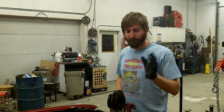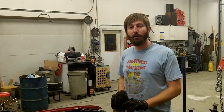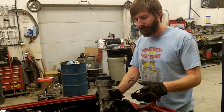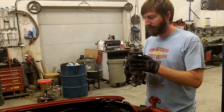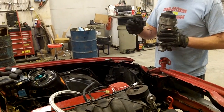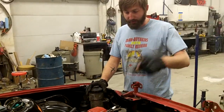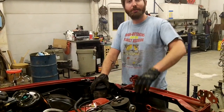All right, guys, we're gonna close this one out. We got our motor all bolted up. We got our transmission mount done. Gonna show you a couple of things we're gonna be working on next time. I did talk to some guys on the forum, and they said try not to run the aftermarket oil filter mount I was thinking of doing. So we're gonna rework our factory housing and mount it over here in our fender well. And we'll show you how that's gonna work. We cut our factory fittings down. We're gonna weld AN fittings to adapt to our Mishimoto cooler and our adapter plate we've already got in here. So next time we're gonna be working on mounting our brake reservoirs, plumb our power steering, mount our oil filter, and we'll just see what else we can get to.